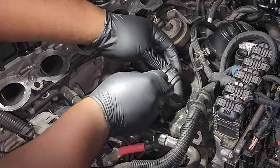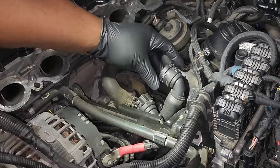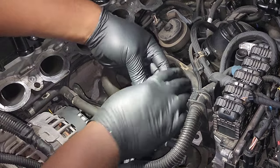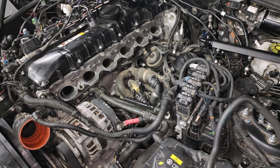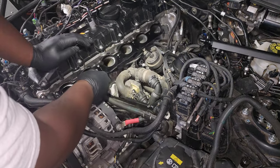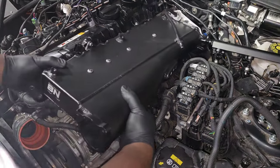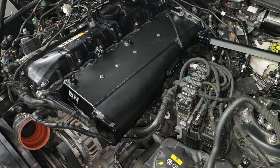Since I like to remove these coolant hose clips so they don't drop down in the engine bay, I'm going to go ahead and reinstall those clips so I can simply clip them back onto the coolant lines on the intercooler. Then go ahead and place the phenolic spacer where it goes — it doesn't stay in place very well, so just get it in the ballpark. Then bring in the intake manifold, take your time, make sure you're not pinching any lines or wires — it's going to be a snug fit but it should install just like the stock one.